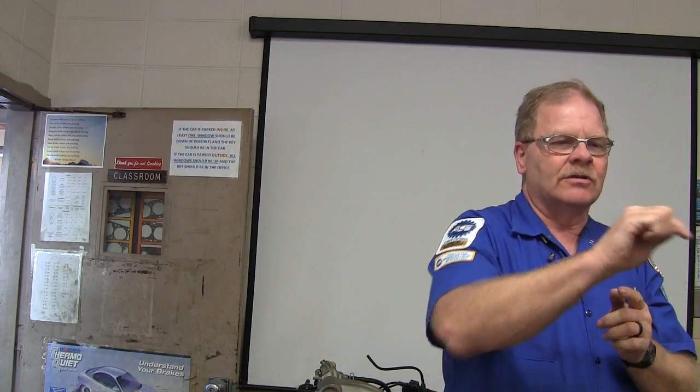Well, that typically won't help you. As a matter of fact, on those right there, when you switch on the key, they'll usually fire some voltage down there to everything and just see if it comes back. And if it doesn't, they'll know that that component's bad. Like for example, if you don't have one side of a component grounded and you shoot voltage down the other side, it does that with the airbag, it does it with solenoids, it does it with sensors, like them wheel speed sensors and all. If it shoots a little whisper of voltage down there and it doesn't see it come back, it's going to assume that you've got an open circuit.